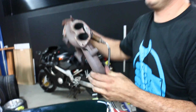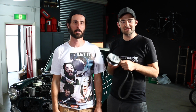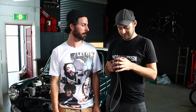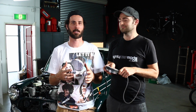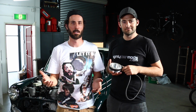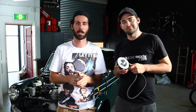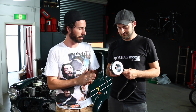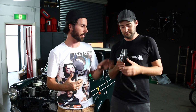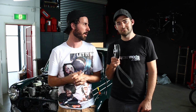It's been a massive day and we've got heaps done, but we've just run into our first major problem. So we've hit our first snag on our mini adventure, which kind of happens when you're customising stuff. That's right. And being that this is a JDM Mini, it's a slightly different kind of setup than the minis in different parts of the world. Some bits of it are SPI, some bits are MPI. But this pulley kit that we've got here to run the supercharger, because the Japanese minis have air conditioning and they didn't in other countries, currently we don't have a way of making it work.